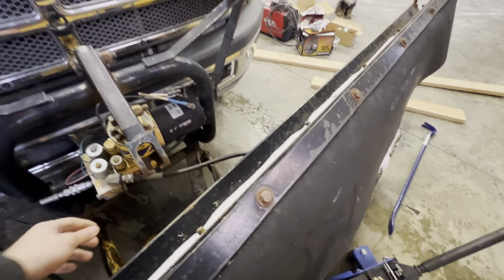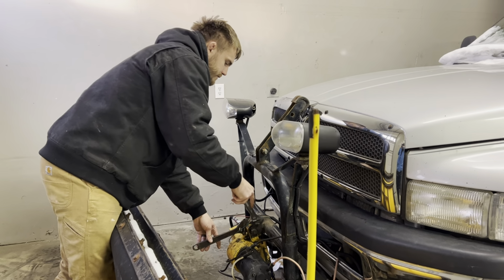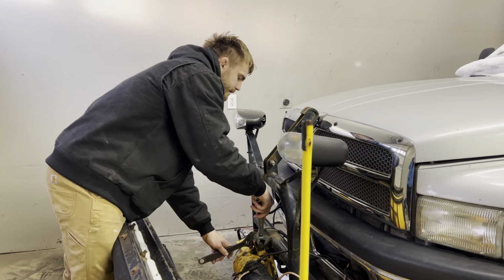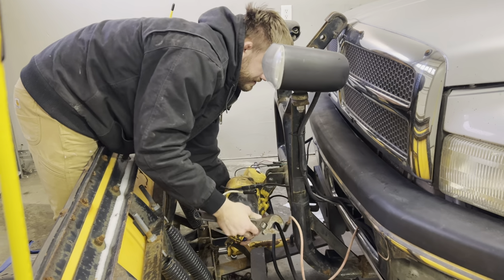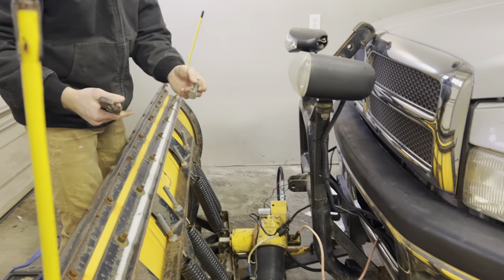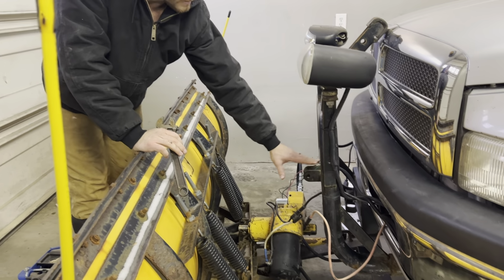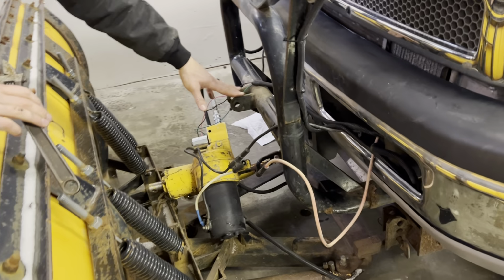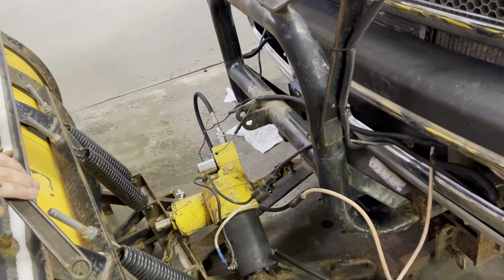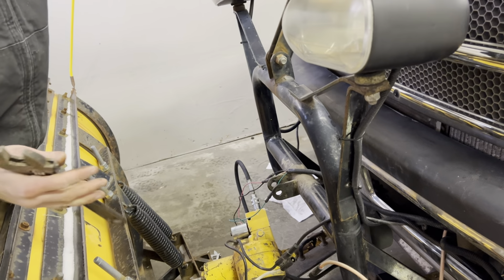Take off the tension. Now I can set that back on the ground. So the hydraulics are coming off pretty quickly, which is nice. It's all easy to get to. So it was really just 2 bolts holding on the hydraulic pump, and that's what kind of leads me to believe that these are going to be strong enough to support the little 3,500 pound winch, because the hydraulics have already been mounted directly on there.